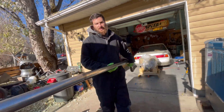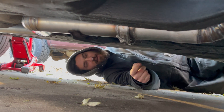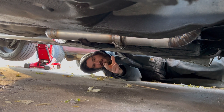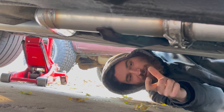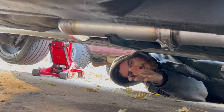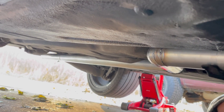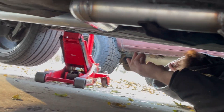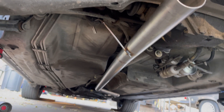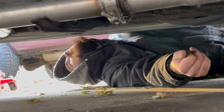Next thing is to start hanging the exhaust. This factory hanger up here cradles it right behind the v-band — that ended up working. Just had to pop it out, clean the holes up so there was more room for give, to drop it down a little more for the bigger pipe. Bung's welded, wires on the O2 sensor — we're ready to splice into the factory ones that drop down here. We're hung on the factory hanger back there, and that's it. Next is the muffler and the tips.